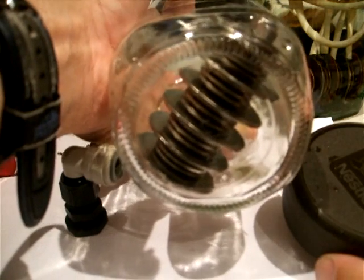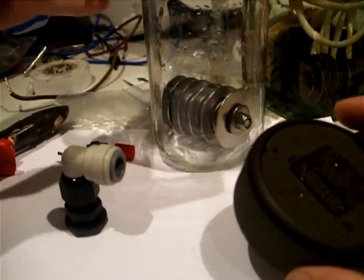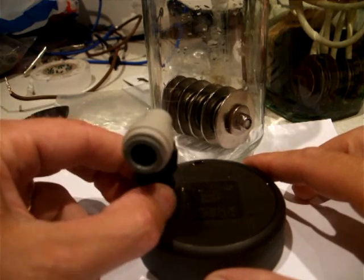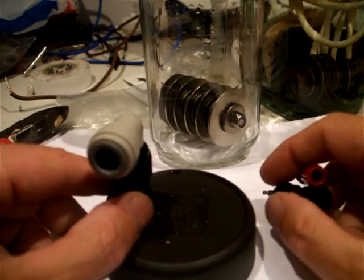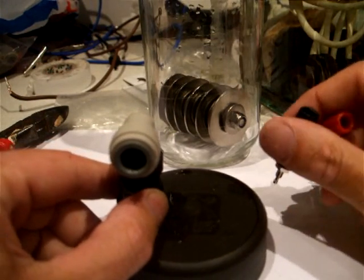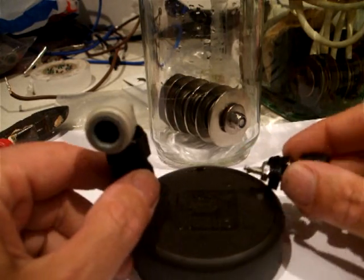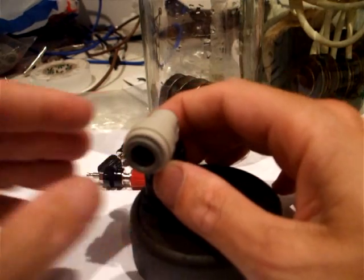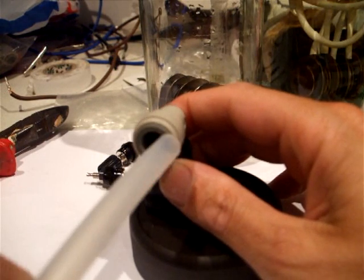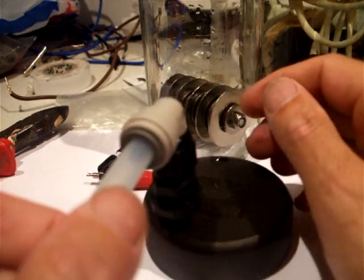This is just showing the cell sitting at the bottom of the jar and rough placement of the exit pipe and power terminals on the lid. I picked up the power terminals from Maplins but would have thought that Radio Shack would stock something similar. The pipe fittings came from a bar installation company although a plumber's merchant should be able to supply something to fit. This one has a surface mount screw fitting. In the future I plan to have the anti-flashback material mesh or wire housed within this elbow, and also a moisture catching fill fitted to the inside of the lid on the exit pipe so as to prevent any moisture reaching the air intake manifold when the vessel warms up.